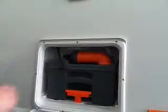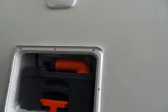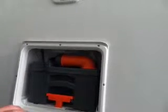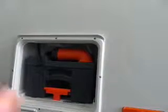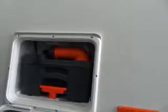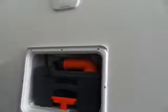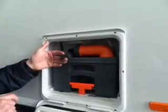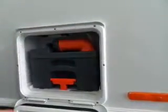On this little shelf, this is the drain for your flush tank. For winter it's very important to drain things down - especially the water system - because the last thing you want is water still in your van and it freezing. If it's in storage and there's water in there and it freezes hard, it can push the push-fit pipes apart. You won't know that until you're trying to get water back in your van and there's water running across the floor. What you can do if the flush tank is a bit full is flush it into your tank to drop the level, then drain the last little bit.